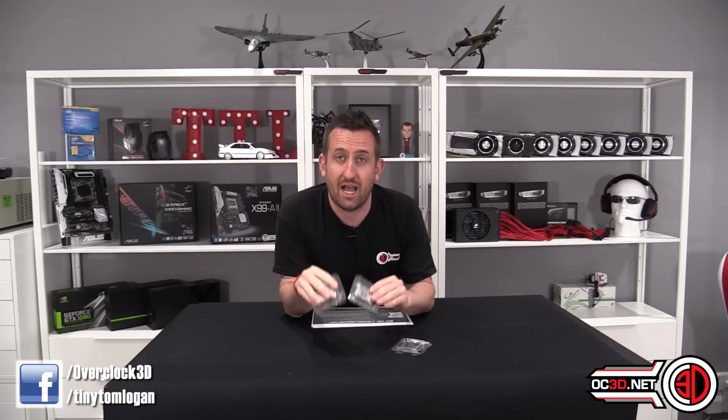If you can pick yourself up a used second-hand one, then all of the vendors are going to hate me for telling you that you will be able to update the BIOS and the new processors will work fine. What this also does mean is if you've already got an X99 setup with a 5820K or a 5930K, for example, and you're all DDR4'd up already, because you do need one of the 2011-3 boards, which are the newer ones with X99. If you have one of those boards already, then you can successfully update to one of these.